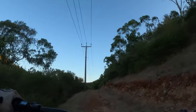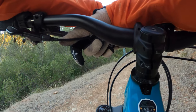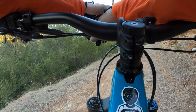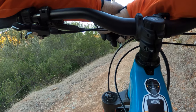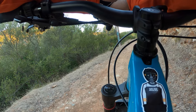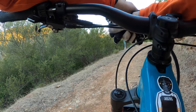Oh, that's killer. So that's quite good out the back at 9 bar. So 10 bar, three clicks was fairly heavy on the compression. And I had to run it pretty much no preload whatsoever, like under a quarter turn for it to be compliant. Quarter turn started to get choppy. Now on that 9 bar, I'm able to go a half turn of preload, so I'll probably just over a quarter, not quite a half turn, and four clicks of low speed compression to get that.